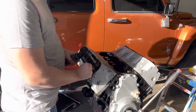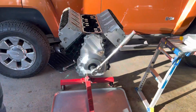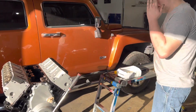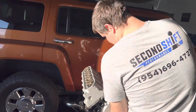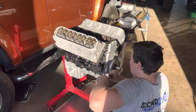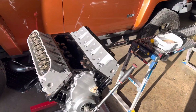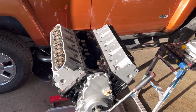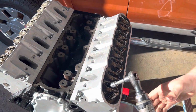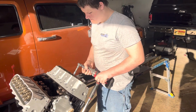Okay, son. All right, that's good. So now we're gonna take this crank and we're gonna spin the crank 360 degrees. So, without further ado, take that and spin that, put it on and spin it one full revolution. All the way around to right where it was. Perfect. Now, go back over your bolts again. I get what you mean. Do you understand? Because what we've done is we've changed the position where some of the valve rocker arms sit.